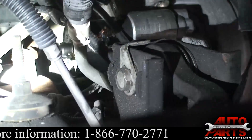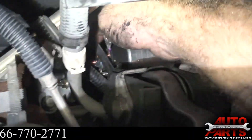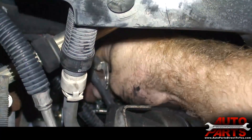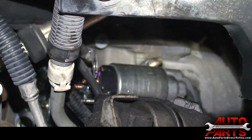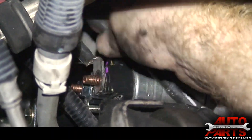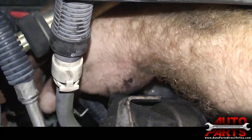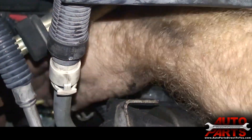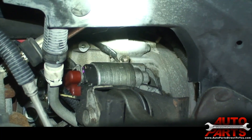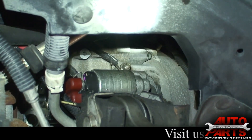I'm going to go back underneath and tighten up the two bolts from under there. All three of the starter bolts are now tight. I want to make sure we get our cables back in the original positions they were on. The big power cable went on this outer stud of the starter solenoid. The smaller signal wire — the yellow one — went on this small stud. We've got all our cables back on, the protective cap back on the wire covers, and the ground strap back on. Everything's tight — all we have to do is connect the battery and make sure it starts.